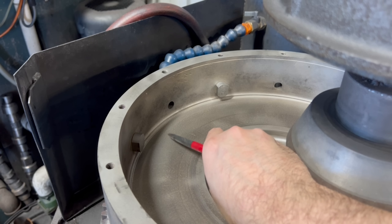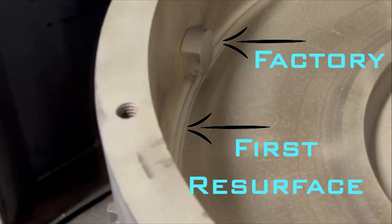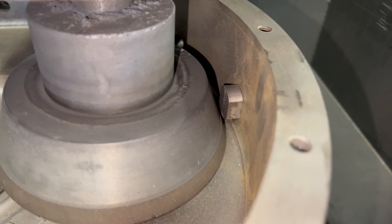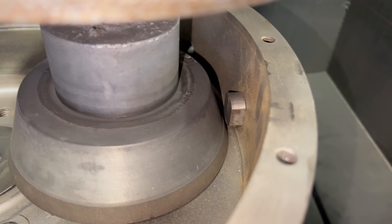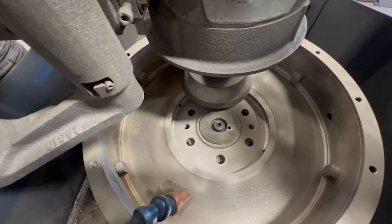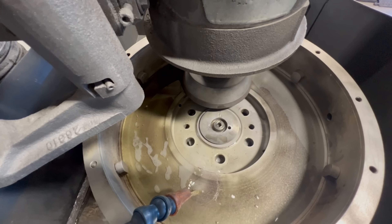It's critical to make sure that we grind the face past this wear point, but it's not necessary to get clear out to the very corner of the flywheel. We can also see that this flywheel has been reground at least once before — you can see the radius from the factory grinding stone in the very corner, and then a much tighter radius further in from the flywheel having been resurfaced at least once before it arrived at our shop. Our CBN grinding abrasive is tapered and will actually reach well outside the clutch wear surface without removing the pins around the circumference, as long as we have the flywheel centered well.